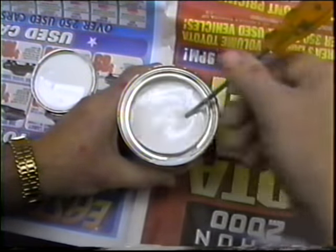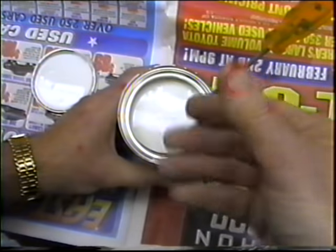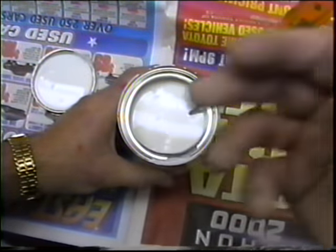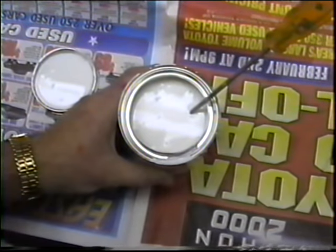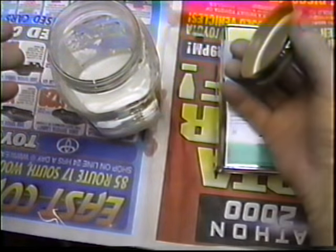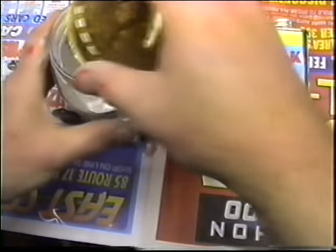All right, once that's stirred up, now I want to carefully measure off half retarder, half Rodak primer for that first coat. One thing, if you put more than 50-50 retarder, it won't hurt. You'll just need more coats. And you're always better with those first coats thin.